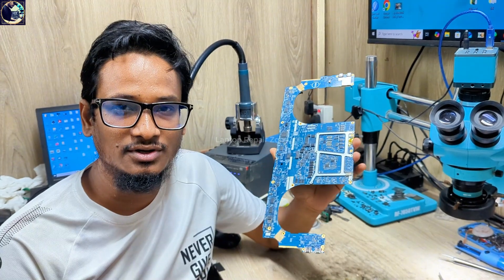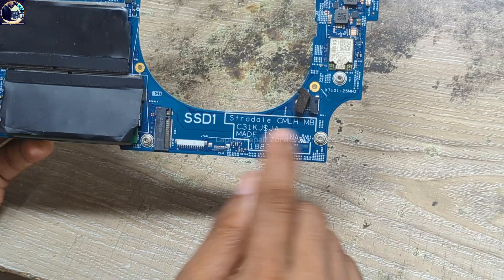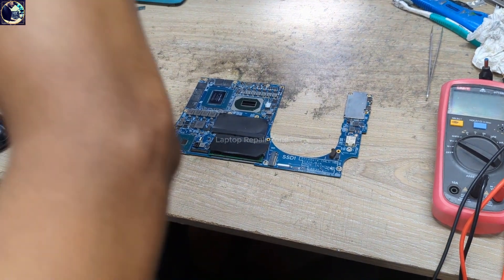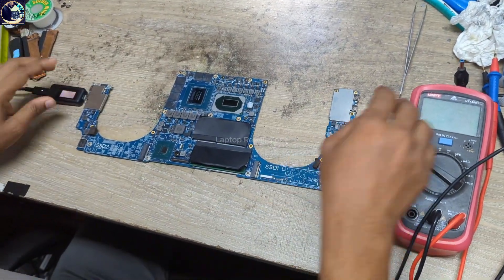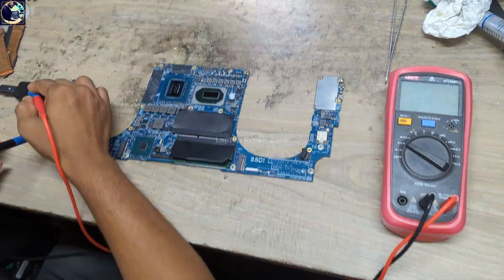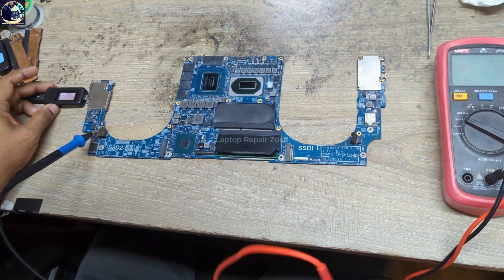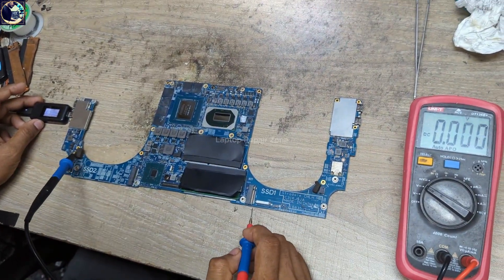This is the motherboard part number. I'll check all the required points one by one to find out what's going on. Let's plug it in and look at my amp meter — it's not taking much current, stuck at 0.10 amps, sometimes increasing to 0.20. First, I'll check the main power rail, so I set my multimeter to DC mode.